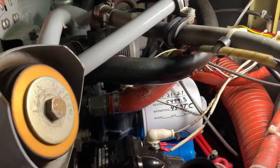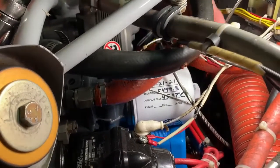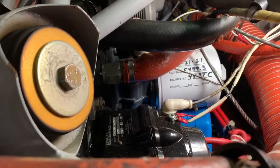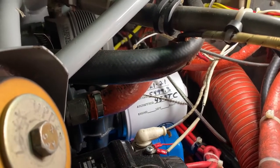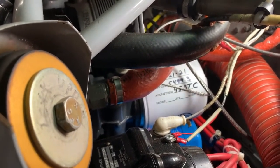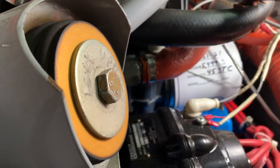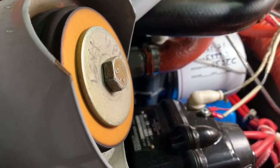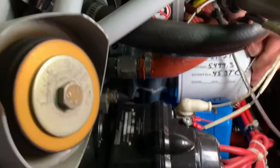Alright, first lesson here. Once you have something to catch the oil in a nice place so you don't lose your tools, that's always a plus. If you cut the safety wire in the middle, your big problem when loosening it is that the chunk gets caught on everything. So cut it down low by where it attaches. Unless you're going to hang the filter to drain — then you want some left on there. We'll cut it back where it attaches to the engine. Watch that little ear on the filter — the ears are kind of delicate, you can actually rip them if you're not careful.